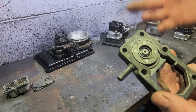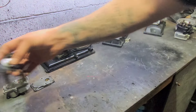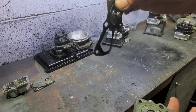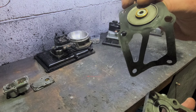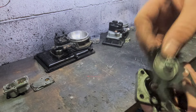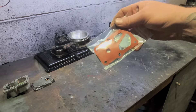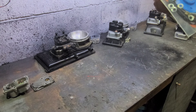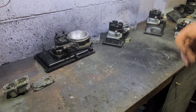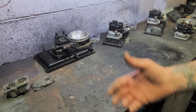So how do you replace that? You can buy the kits — I'll put the link in the description. For example, this is another one I've acquired. That diaphragm in there is split and falling apart, and this is a rebuild kit that was used previously. That's not a very good diaphragm — it's not even that strong, and for it to have split already, that's a poor quality diaphragm I wouldn't use. I've tried and tested things. These diaphragm kits are from missingparts.de. I speak to Ruben quite a lot — he's happy to help, unlike a lot of companies who supply parts but aren't interested in helping you. I recommend them because I've used their parts in all the work I do, and if I need specific parts, I go straight to him because they are proper quality.